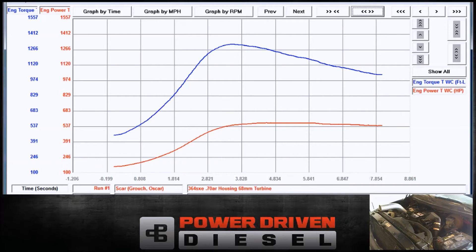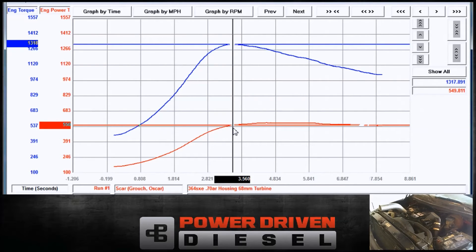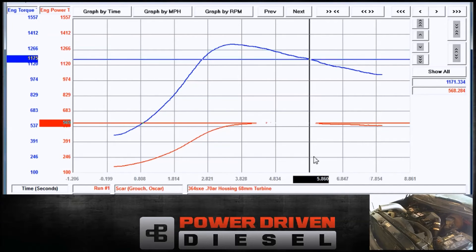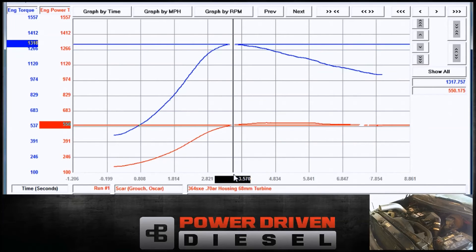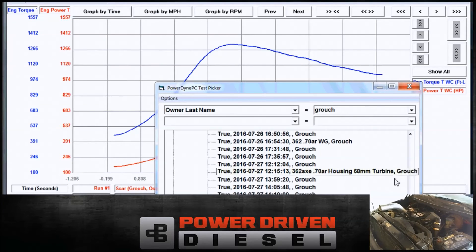Let me walk over to the computer and we can look at this graph. Our peak horsepower and torque numbers for this run: looks like we're at about 571 on peak horsepower, and our peak torque was 1,318 — so we're over 1,300 foot-pounds at the ground. The horsepower holds real nice and flat all the way to 2,800 RPM, still over 530 horsepower — it's just rocketing even at that RPM. Looking at our time, from zero seconds to peak torque is about 3.57 seconds — three and a half seconds from that roll-on to peak torque. Now let's overlay the 362 graph and compare how it did to the 364.